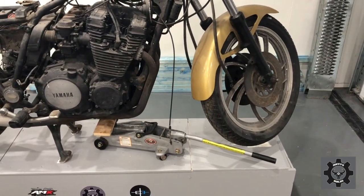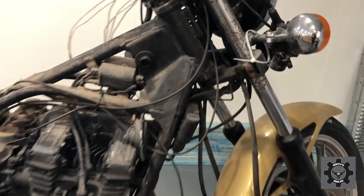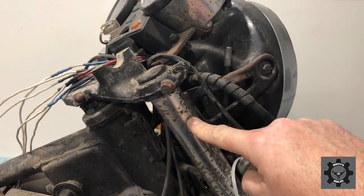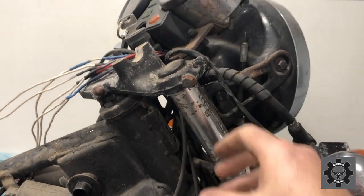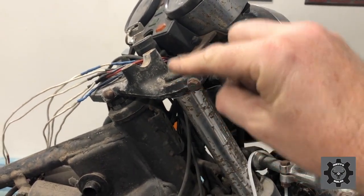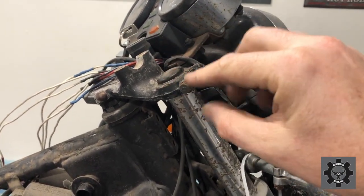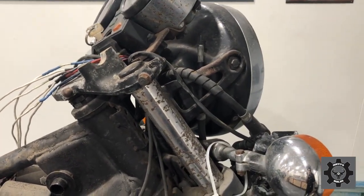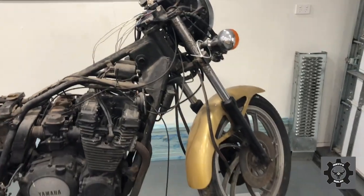So we'll drop that front wheel down, and hopefully that's enough - probably have to go a little bit higher, drop this front tube down. Slot them on there, bring them back up, then we're going to look at how much we're going to lower the front of the bike. I'm thinking probably at this stage, around about a 20mm drop in the front.